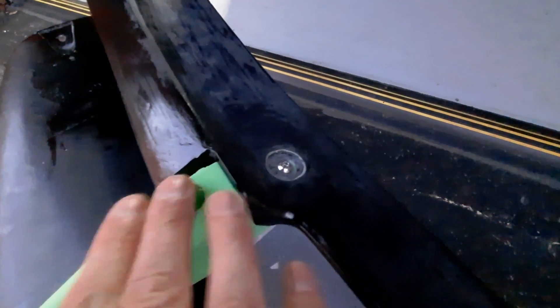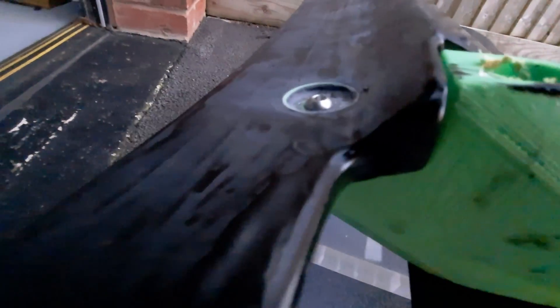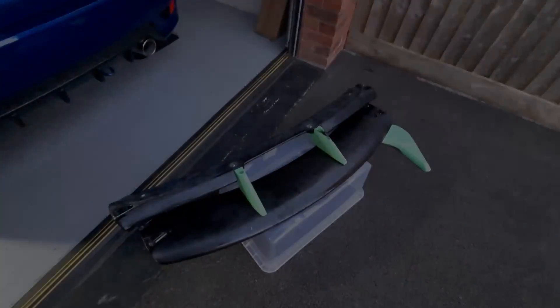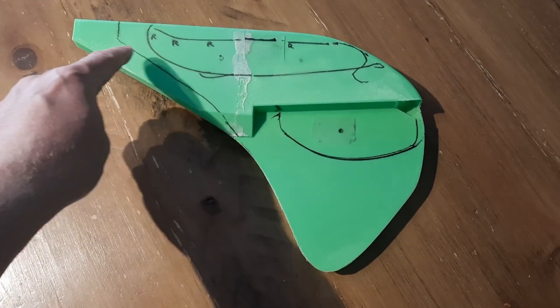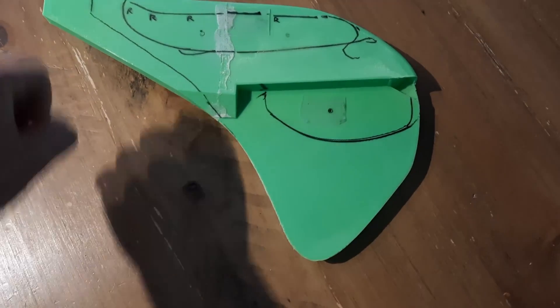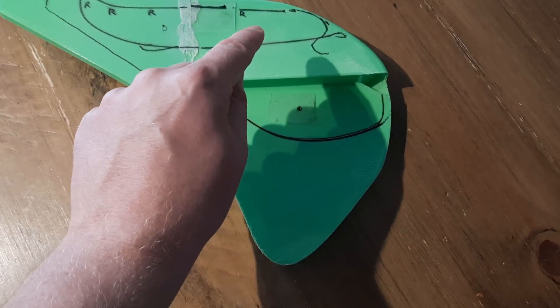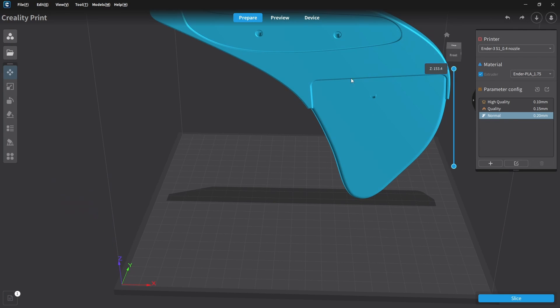I've also been investing a lot of time behind the scenes in getting the rebating and the fasteners right, thinking about how I'm going to connect the upper and lower spoilers together so this thing can be dismantled into its component parts — you can paint them, you can install them anywhere you like. The intention is to trim down the trailing edge, make some little recesses, improve the hole positions on the upper and lower spoiler, put a little rebate in so it all looks nice and flush when assembled, and give a bit of room for some tiger seal if you want a more permanent connection.